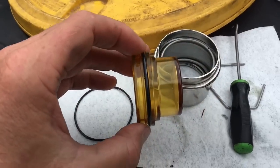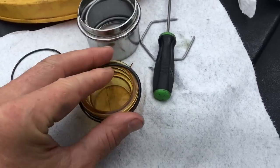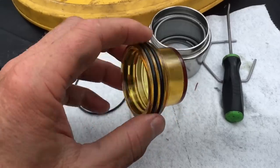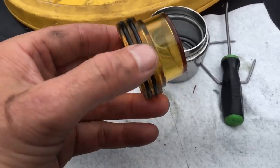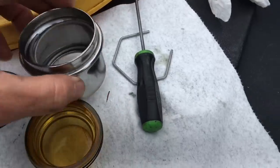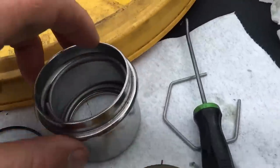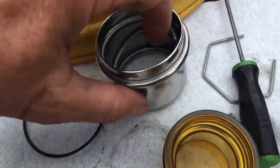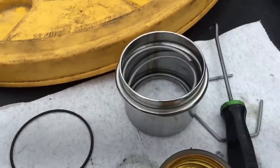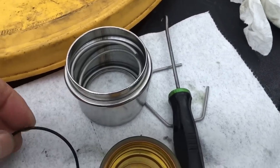I'll show you putting this together. This goes on here — it's got two o-rings on this version. I bought some new ones and they appear to be the same. These o-rings are still nice and supple and bulged out well above the edge, so they should seal fine. The o-rings seal on the inside of this cavity, and very often that cavity gets really gritty from road grime coming in from the outside around the casing. That grit can itself create a leak — I think that's one of the reasons we find failures in this particular system.